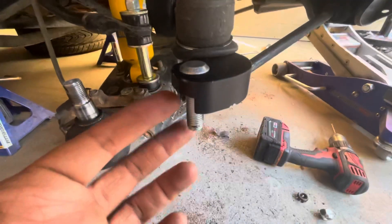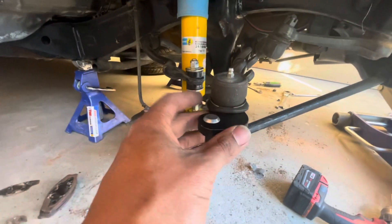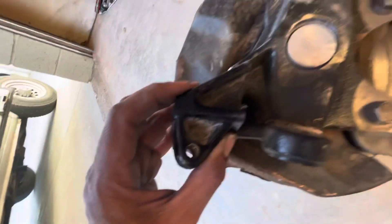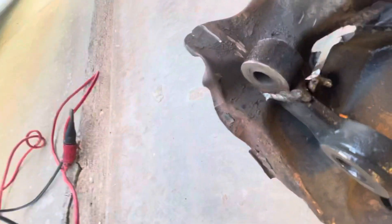It's not gonna work — I can't get this part tight enough on the spindle. It moves back and forward, and that's a risky move. So what I did is what I didn't want to do from the beginning, but it's gonna work. I cut that piece — it's supposed to fit like that in here — and I made it shorter. That's the final result. I do NOT recommend you to do this, because if that part breaks it can cause an accident. I did it because this truck is a track-only truck.